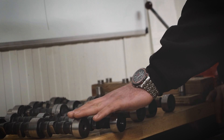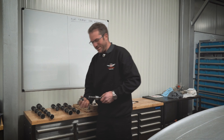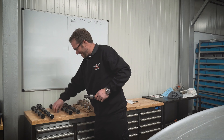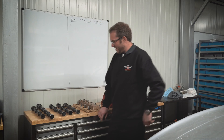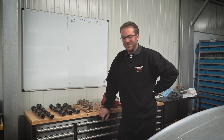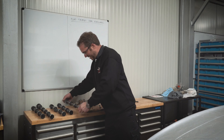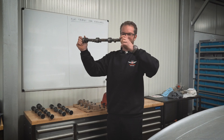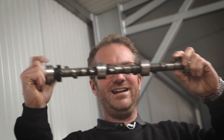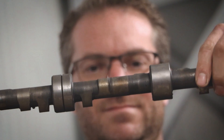Let me quickly show the rest of these camshaft failures on my bench. The first was a standard road cam with general wear. The second was about to become a major failure but was caught in time. The third is a pretty major failure - actually in three pieces. This one broke because a rocker arm stud snapped inside the engine and parts of the rocker arm went down into the engine, jammed the cam, and snapped it in three places. Then we have a reprofiled cam that was driven even after it started to fail - the cam lobe has pretty much become round. That just shows how, once that tappet is damaged, the cam will continue to eat itself.